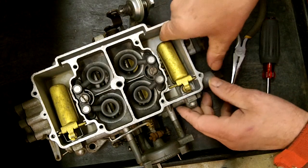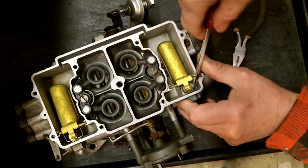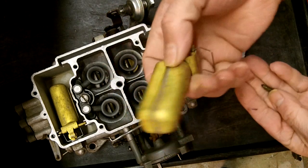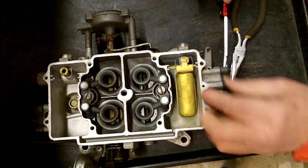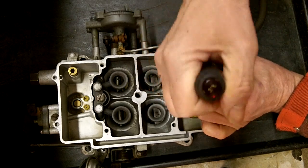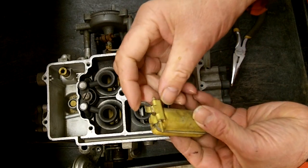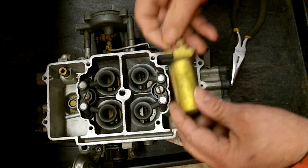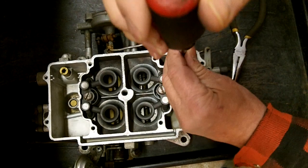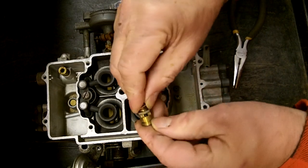There's our gasket. Interesting — these are some really old chokes on them. I think this is a real early 4100. And that float's definitely no good — it's full of fuel. That was the primary side. I don't know if you notice these clips that are on here. That one's empty, but here's a clip. This is what holds it on to the seat. You put it down in there and clip it over the little edge on the seat. There's a little indentation right here — that's why that is there.